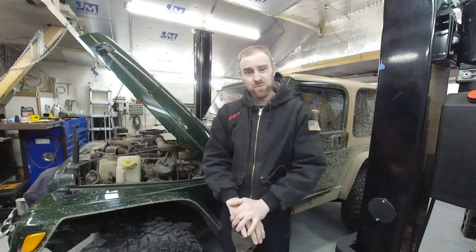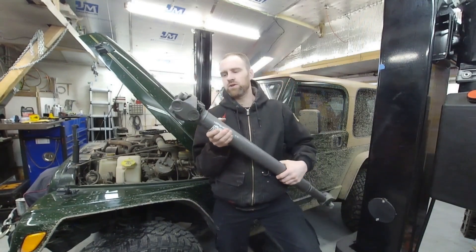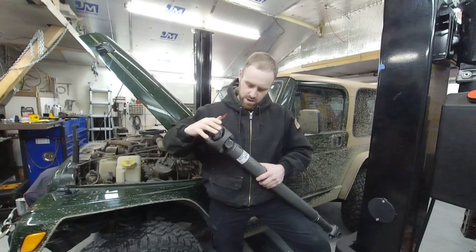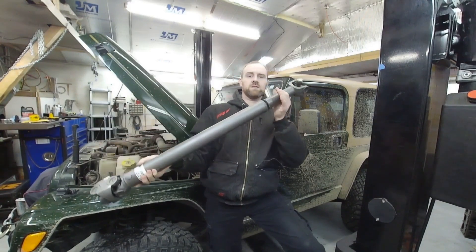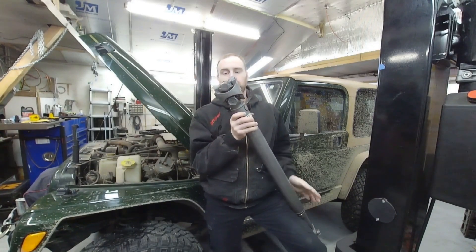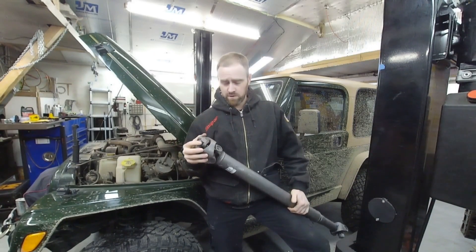The particular drive shaft that we are replacing on Craze Performance Repair today is called a double cardan joint, I believe is the correct term. It's got a really unique joint to it. Here's the entire drive shaft — you can see it's like a normal U-joint on this end, and then on this end you've got this unusual thing. These things are actually very prone to failing; it'll create a weird shimmy or shake to the vehicle.